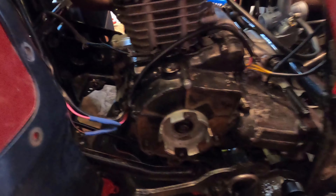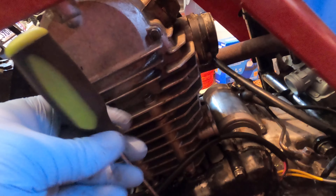We're going to take off the tensioner — both sides are 10 millimeter, very easy. Pop that out and continue. Now we're going to set the engine to top dead center. Take off the camshaft cover — two 8 millimeter bolts — pop that off. I'll show you how to get to top dead center: take off the dial at the top using a flathead screwdriver and find the T mark, then confirm it up at the cam gear.